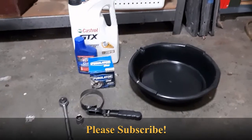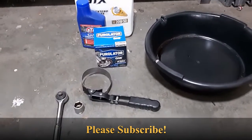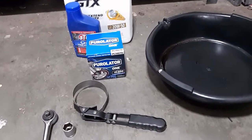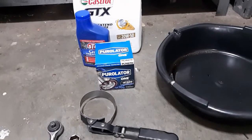Let's take it back to basics and do an oil change on our MGB — this is a '77, the rubber bumper version. You may have a type that has more of a canister. Pretty much for what we need here: I've got a pan, a 3/4-inch socket for the drain plug, and an oil filter. I've been using the Purolator PL14670, which fits real good.